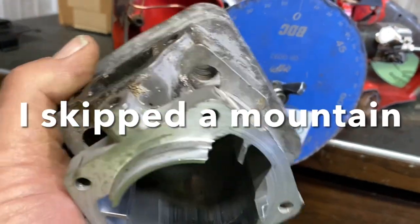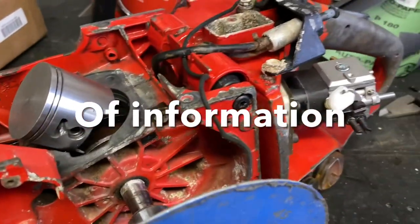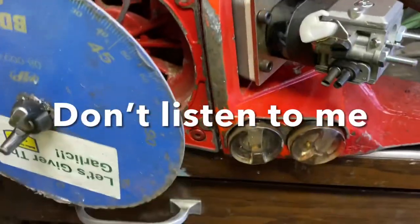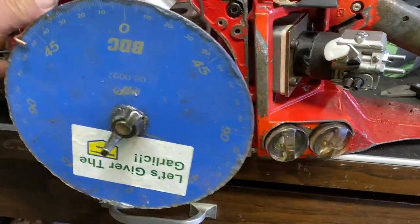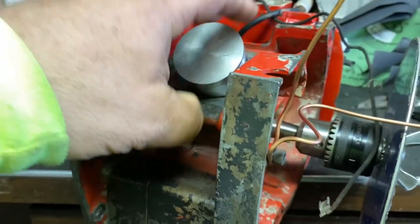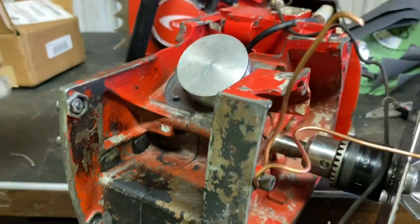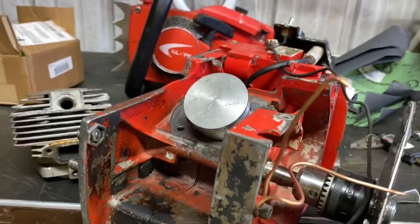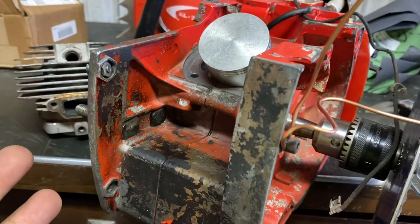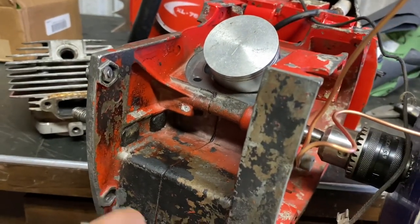For the transfers, I don't think I'm going to raise the uppers. The reason is because I increased crankcase volume by using this reed - it sits back further than the original, so that extra distance and volume increases the volume of the crankcase. By doing that I lose crankcase pressure, so in order to make up for that loss in pressure I want the transfers to open later to help compensate. I also need to increase velocity through the transfers.